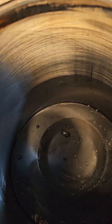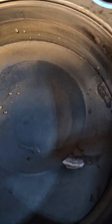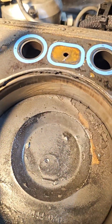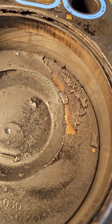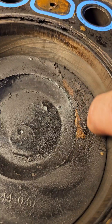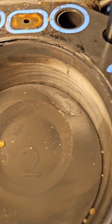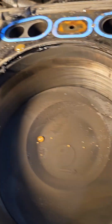It hit right in the middle. I don't know that it hurt the pistons — you can't leave something sharp in there because it'll glow and cause detonation, but that's just some carbon on that one coming loose there. The front one didn't get any — it survived. All the others got a hit.